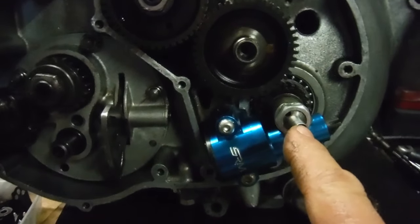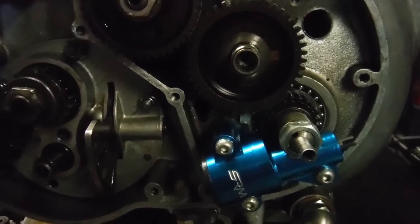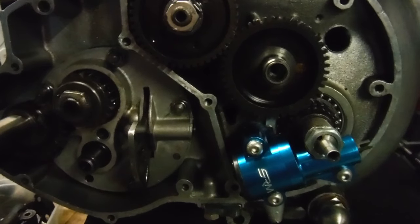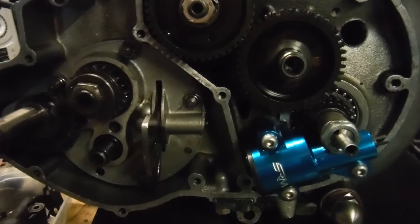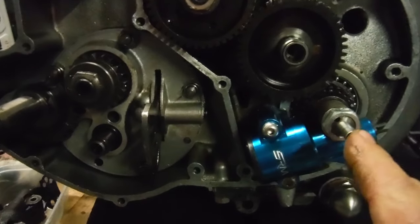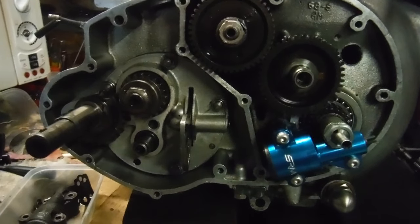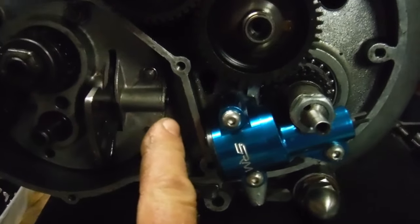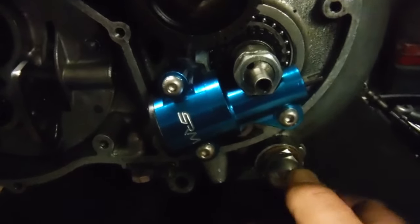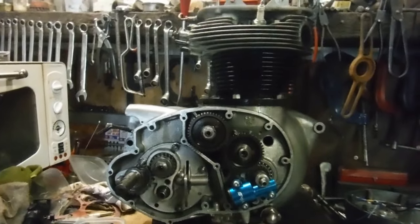As it's an end-fed crank, I'm going to apply my oil can to the end feed on this — it's actually a Devimead conversion, which predates the SRM that they became. I'm going to squirt oil in through the end feed to help fill up the sludge trap chamber. I oiled the big end shells when I assembled the crank and oiled the journals as well, but getting some oil pumped in there will do no harm and is another small step towards helping the engine when it fires up.